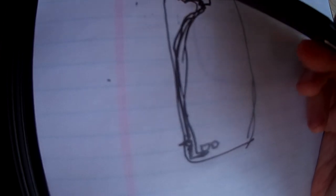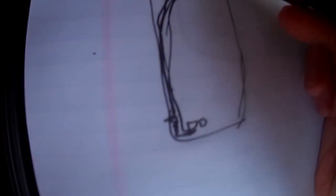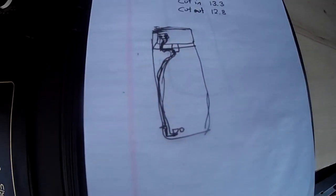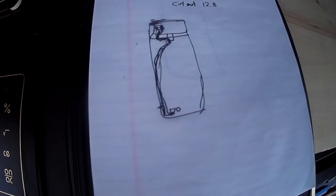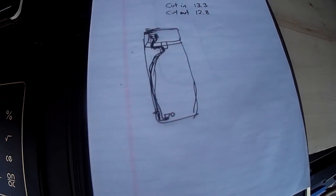This is a three-wire setup: positive to the isolator, then positive coming off the isolator to the two batteries, then negative straight to the battery, and then you just have to ground it. It's really that simple to do, except for drilling through the firewall in the front — that was a bit hard to do — but it's done.